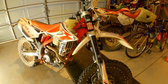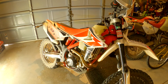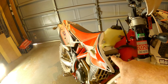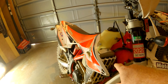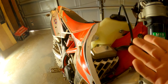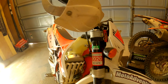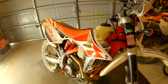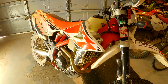Overall this bike has been a pretty good bike, but it had a few negatives off the bat. There was a weird wire from the cooling fan area that was routed wrong and melted on the radiator — it went around one of the brackets and shorted out, which took out the headlight, the cooling fan, and the electric start. So I could only bump-start it.